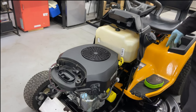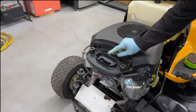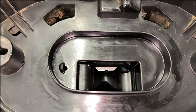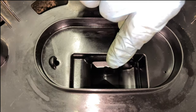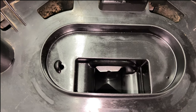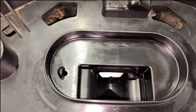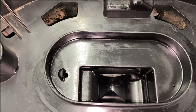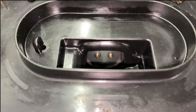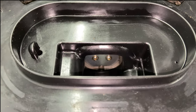Okay, so that wasn't too terrible at all. Just make sure you check inside here — when you put your throttle all the way up to fast, you do not want this to actually move that choke plate. As soon as you bring it up past fast, just a little bit, just like that, you're going to see it close all the way. And that's pretty much adjusted perfect — this thing will start up pretty much every time now on choke.